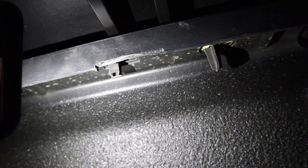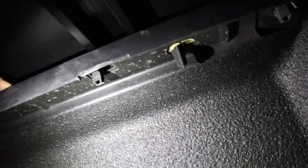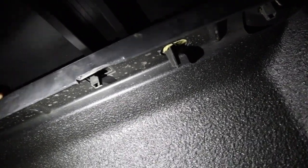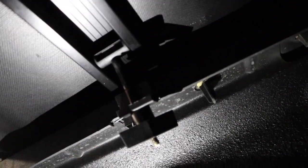I'm guessing the previous owner had a cover on and cut it out too, but where his is cut out and where mine's gonna be cut out is different because he had it positioned differently than how I want mine. That's what you have to do. So down here — that's where I cut mine out right there. You want to cut the plastic so you're right on the metal for maximum support. I tried just tightening it without cutting and it was just bending the plastic, so you do have to cut it out. Then you just pull these over and crank them down.